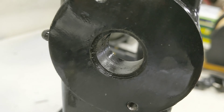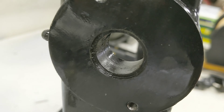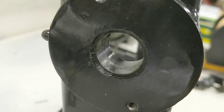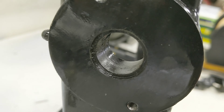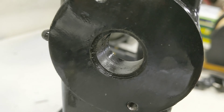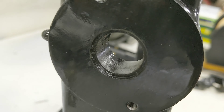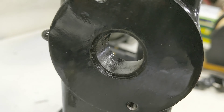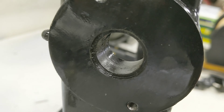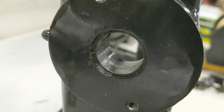It had a split in it, so I just cut through right there. You can just barely hang a fingernail on that thing — looks great. Way down in there you can see that bushing coming out. I basically took the Dremel tool and sawed through the sides of it just like I did on the other one, then took some screwdrivers from that hole down in there and pounded them in. Now you can see those bearing shells are just sitting down — I just gotta peel that out. There it is out, all mangled. Not a very surgical job but got it done without too much damage to the housing.